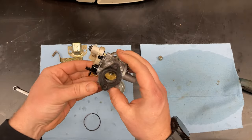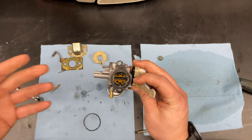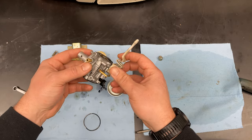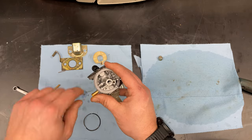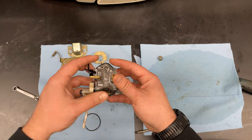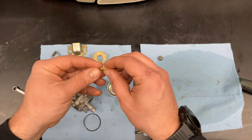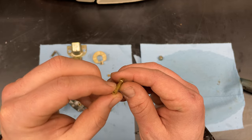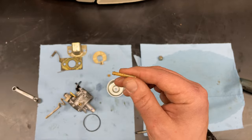Here's how things look after I put it through the cleaner — much more clean. But of course, if you just use a toothbrush and some WD-40 or some other sort of cleaning solution, you should be able to get it to almost as clean. Most importantly is carb cleaner on the internals — that's what we're really after. Most importantly is the emulsion tube and making sure all of these holes are free of any debris. This one looks perfect. Let's put it back together.